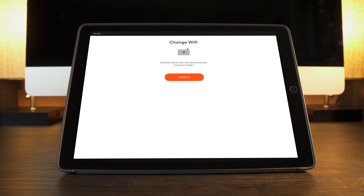I know I'm a little nuts with that kind of a password, but the Sense only handles passwords of 58 characters or less. And this isn't stated anywhere inside the app or online, so there was a lot of back and forth trying to figure out why it kept hanging on the connecting to WiFi stage. I figured out the problem when I was able to get the Sense to connect to the guest WiFi without any issue, which was a much shorter password. While it was frustrating, it was ultimately an easy fix. At this point, the setup is basically done.